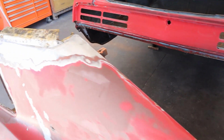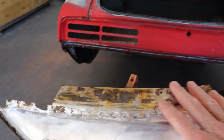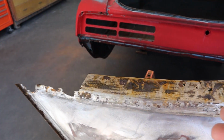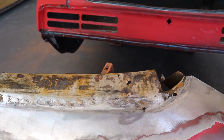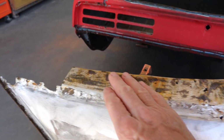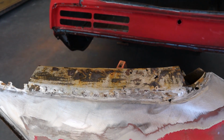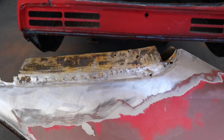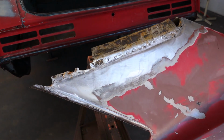And then, of course, the leading up here. This is leaded in fairly heavy. I mean, these things were spot welded together, really rough, and then you guys will see it when I unlead the Ruby on her sail panel. And then, this kind of spot welds this on here, and then they just cover the whole thing. That was their body filler back then. And then they would file it down. They did excellent work, beautiful work, but it is kind of difficult to get out of there, but I'll show you guys how to do it.